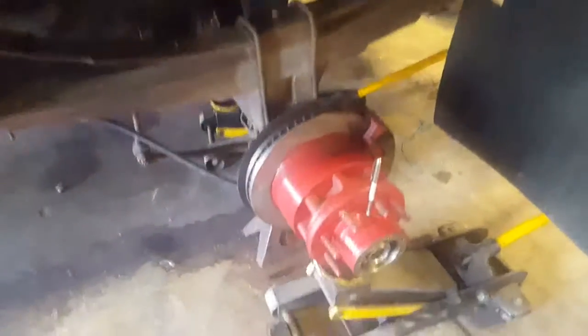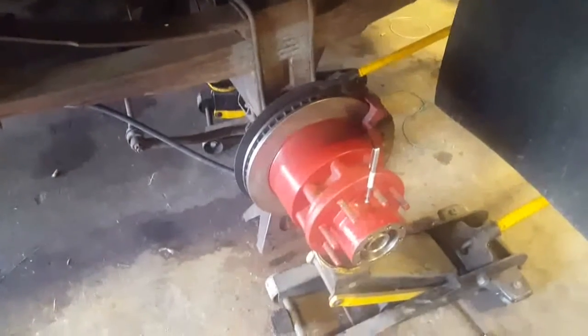I wish I'd done the whole video of this. I didn't even think about the teardown and everything, but let me show you the reason I'm doing this. I put new pads on this rotor 2 years ago on the rear discs. It had a few little craters like this 2 years ago, but it's just totally escalated here. These are deep pits in this. I think this is from faulty casting. This disc is 14 years old. This is 2016. These are off an 02 model, so this side's not as bad.